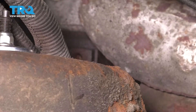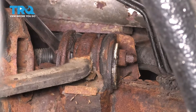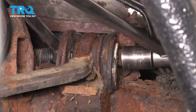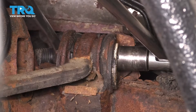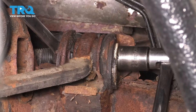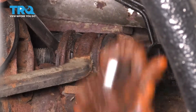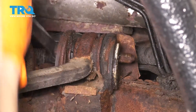Now the ABS wire has plenty of space to come down with the knuckle. I'm going to free up these bolts before I take the control arm out of the knuckle — it'll be a lot more sturdy this way and it won't twist and move around. I have a 20 millimeter wrench on the bolt side and a 21 socket on the nut side. I'm going to try and break it free with my breaker bar first, and that broke free. I'm going to switch to a ratchet. The nut is coming off surprisingly easy and the bolt is moving — that is a very good sign.